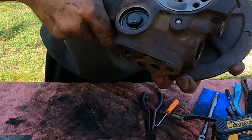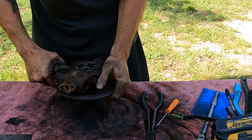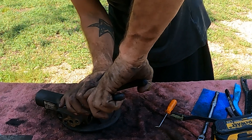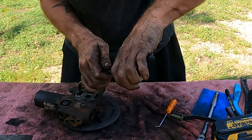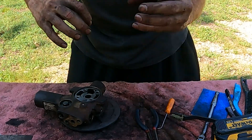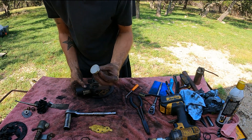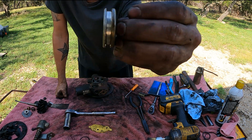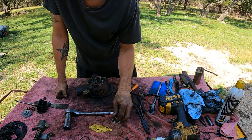See if you can see — it's nice and snug down in that position. We're going to take our pliers and just turn it a little bit to make sure that it's in the grooves real good. Now we're going to get the rebuild kit because we need an o-ring for this plunger that goes on the backside of that VGT piston.